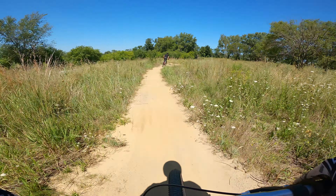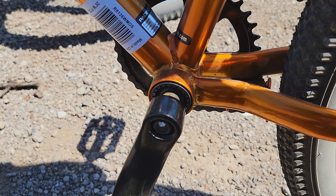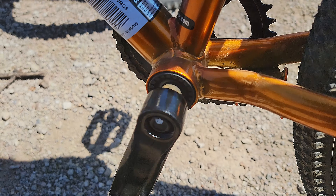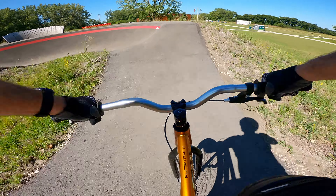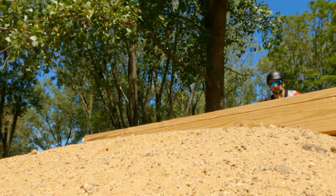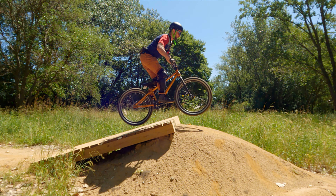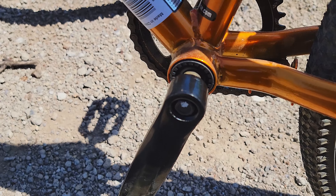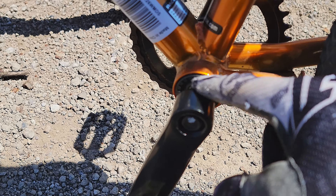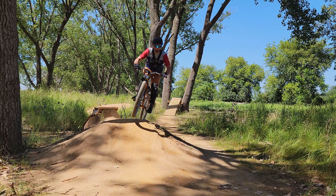A not so bright spot? The crankset. Just after a little bit of riding, it vibrated loose. Brand new bike — technically hasn't seen a lot of use. The bottom bracket is made out of plastic. Do you trust that when you're jumping? I'm kind of done with this. It was tight when I left home, but after a few hours of subpar jumping and riding the pump track, the cranks vibrated loose. Luckily I caught it while pedaling around on the gravel, or this would have ended badly. So now I've lost confidence in the cranks. Any cranks can vibrate loose, but I've never had one do it this quickly. At closer look, the bolts are cheap and the bottom bracket on this bike is made of plastic. I don't see these lasting very long, and if you don't have confidence in your equipment, you won't have much confidence riding.